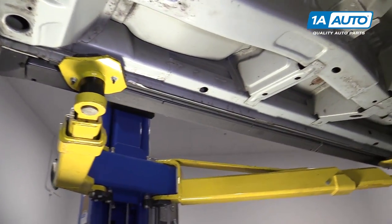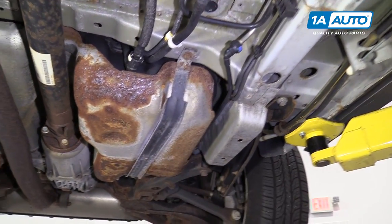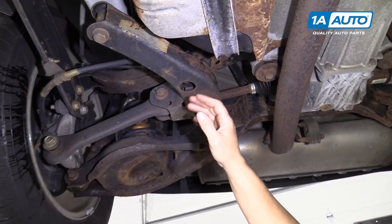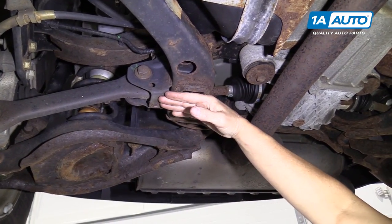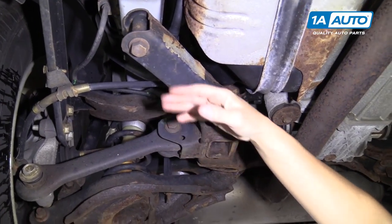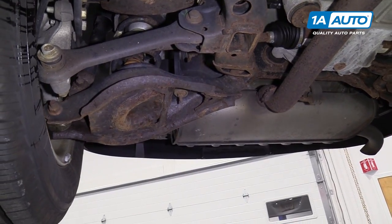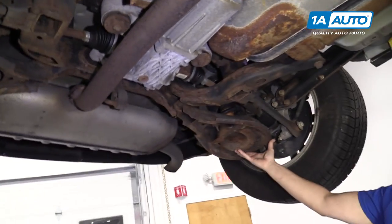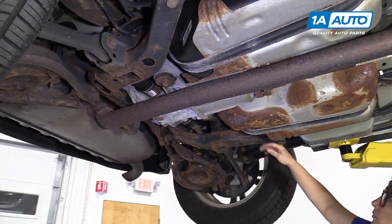You have four points. In the rear, there's only one place to put a jack and a jack stand, and that would be the subframe right here. A nice level flat spot, and then I would put a jack stand right here, or jack it up here and put the jack stand there. You never want to put it on the control arm because of the angle, and you can repeat on the other side. Flush, not the control arm — jack stand.